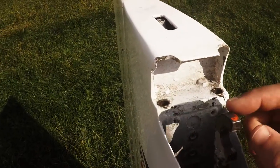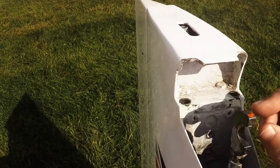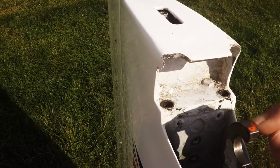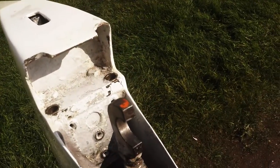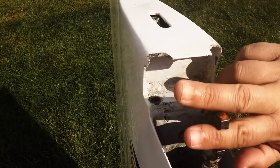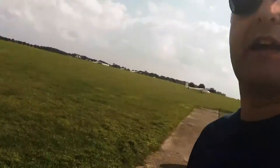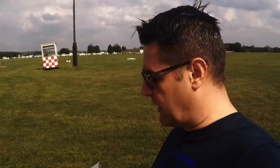What I've done is put some vinyl on there — I rubbed it down with sandpaper first, put some isopropyl alcohol on, and then just put a piece of vinyl across. You can see it's worn out so I need to put another one on — some nice fluorescent red-orange vinyl. Basically, that then lets me see inside: if I can see the red over there, then I know it's been engaged properly. That's really how I make sure the tailplane is engaged.